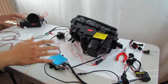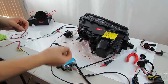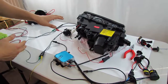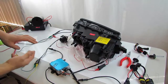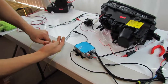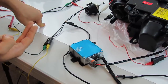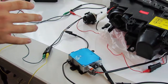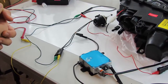I strongly recommend you take the time to retrace your wires to see where you're losing contact. If it's a polarity issue — just like with your ballast — make sure this connector is polarity correct, since you have the Bi-Xenon shutter activated. The wire that's been tapped is your positive; the wire without a tap is your negative. Make sure the orientation of your 9005 factory connector for the halogen high beam is correct. Hopefully this provides a better interpretation of what we're asking you to double-check. Please update us regarding your findings. Thank you so much for your time.